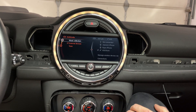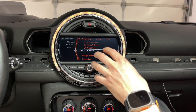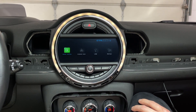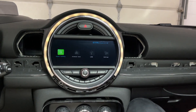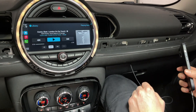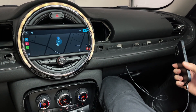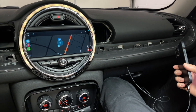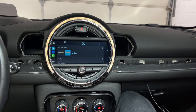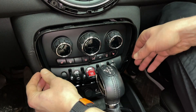For testing, turn on the ignition and choose the sound source in multimedia as auxiliary — auxiliary is going to be your sound source for CarPlay and Android Auto. Then press and hold the back button in the center console. You'll get a new mode you didn't have before. Take your iPhone and connect the cable to the USB. As you can see, CarPlay is working. Check the maps, check the controls, check music, and verify that audio is playing — everything is good.